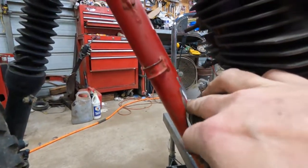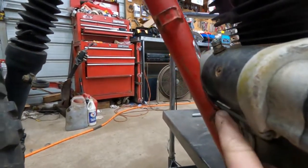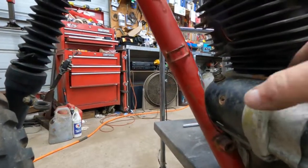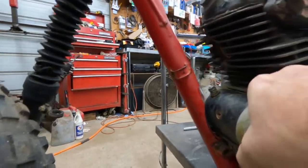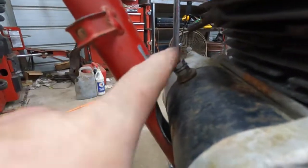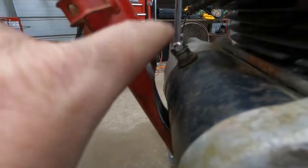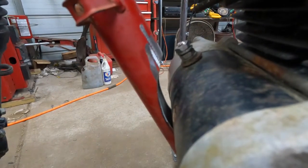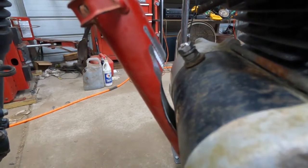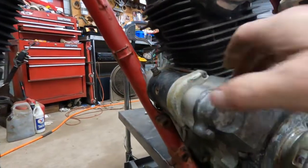So it looks like we've got plenty up here to insert that piece of pipe. It does get a little tight here where this support bar is. There's a one on the bottom here on the starter. We can index the starter a little bit, try to get that out of the way. We're gonna run into this stud getting really close to the frame, and I don't like that. If it rotates while you're riding, it's 12 volts right there when you hit the key. And so I'd prefer to keep that further from the frame if possible. But I'm pleased about that.